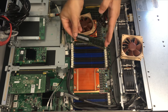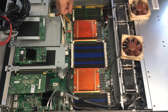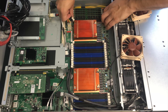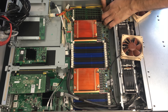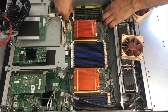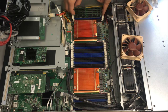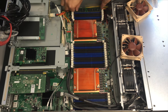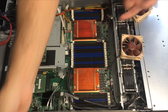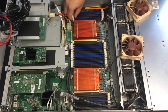In case you're wondering why I don't just pull out the USB 2.0 stick and stick it in here — that actually houses the Unraid operating system. One of the reasons is because this server has a particular issue where the BIOS uses up too much onboard storage, so it can't actually boot by itself without user intervention. I literally have to press F1 to skip some boot thing to get the server to boot to Windows.